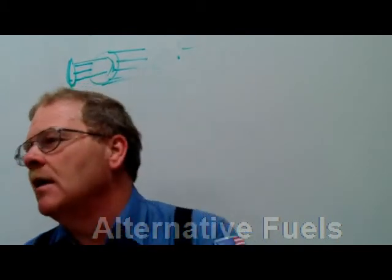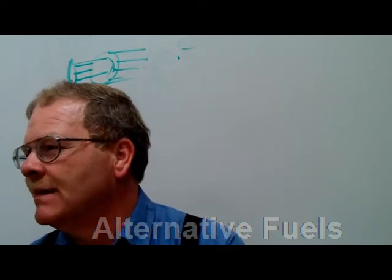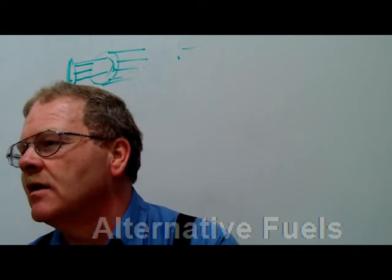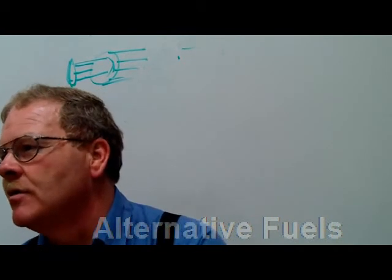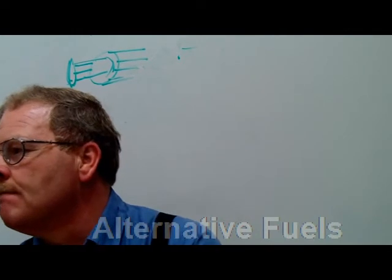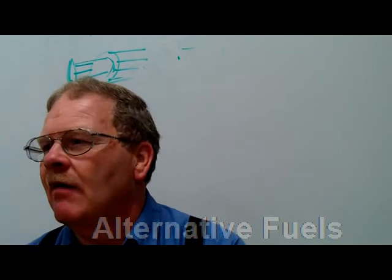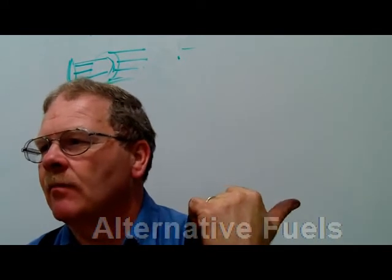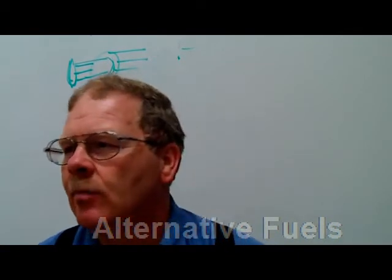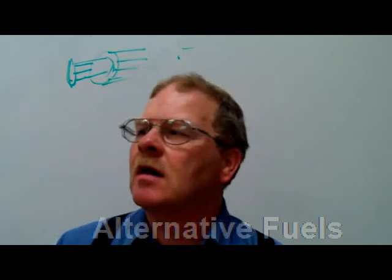14.7:1 by weight. A car burns 9,000 gallons of air for every gallon of gasoline. But that's by volume. By weight, you're basically looking at 14.7 pounds of air for each 1 pound of fuel. So that's why I say 14.7 is the optimum air-fuel ratio, right? It is, because if you draw a graph, and you can see a graph on the front of the exhaust gas analyzer, if you go richer than 14.7:1, your hydrocarbons and carbon monoxide go up.